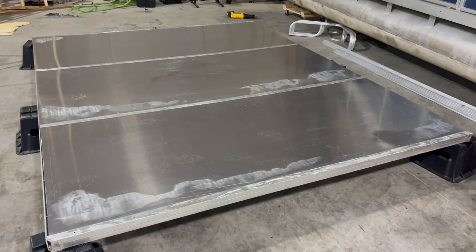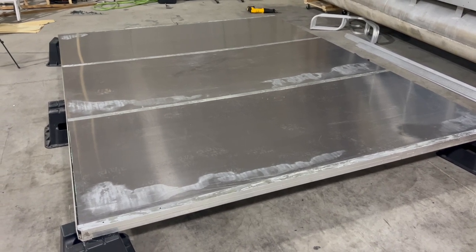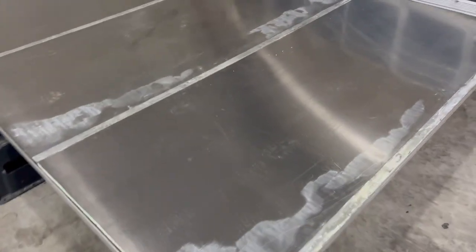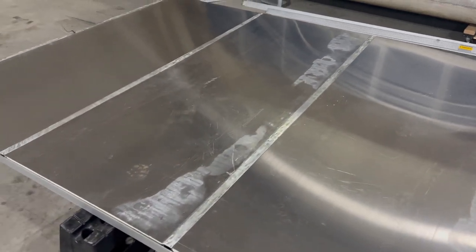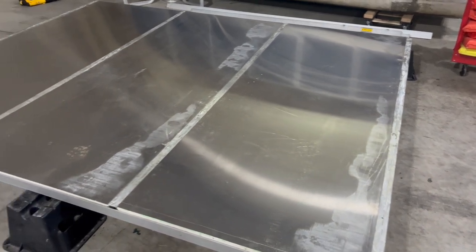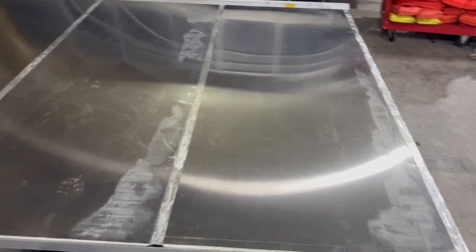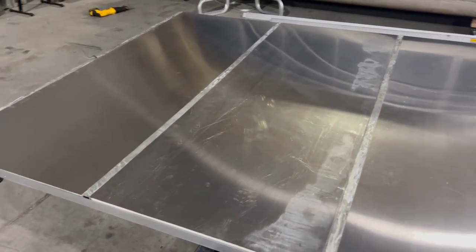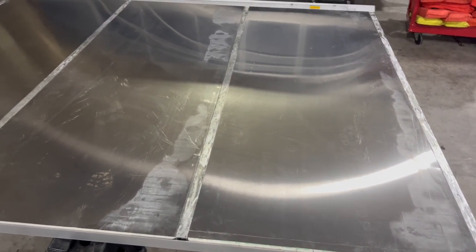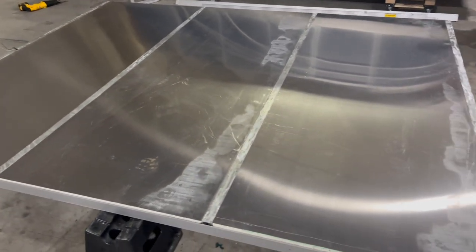So we've got our aluminum sheeting on. Long term this is going to be stronger, it's not going to crack - it's way less flexible than the sheets of fiberglass - so not only does it give us something better to adhere to, but it is going to be sturdier. What we're going to do now is just scuff this up with a sander to give that glue something better to grab onto rather than just that shiny, smooth aluminum. We'll rough that up a little bit and then do a sample of what we're going to do for the vinyl on a scrap piece of aluminum. I always recommend folks do that anyway so you can learn how the process and the timing works.